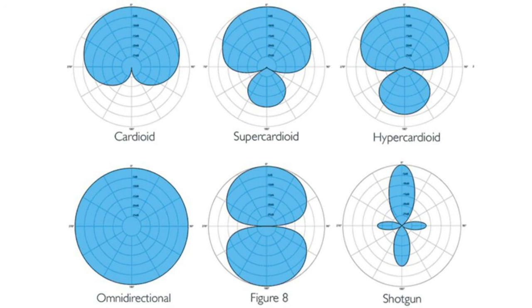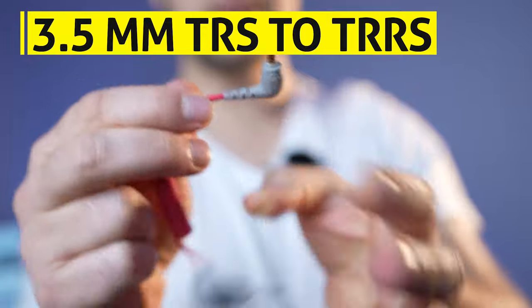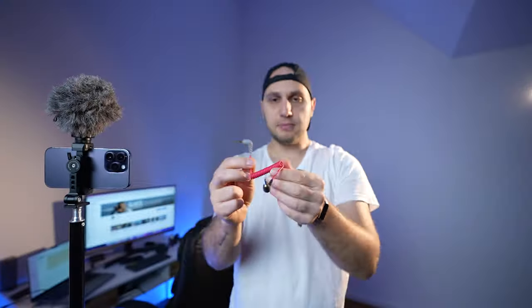You have to be careful when purchasing a microphone and check the sound capture pattern, because there are microphones that look similar but capture 360-degree sound. To connect it to the iPhone, we need two things: the iPhone headphones adapter and a stereo cable — but not a stereo-to-stereo cable. On one end you have two black stripes, and on the other side three black stripes. So be careful which cable you are purchasing. Push the end with three black lines into the adapter and the end with two black lines into the microphone.